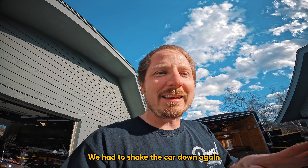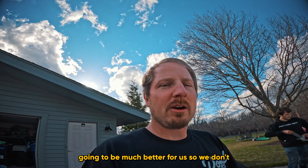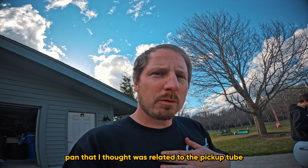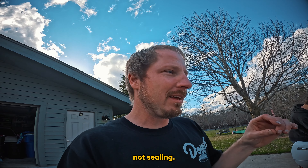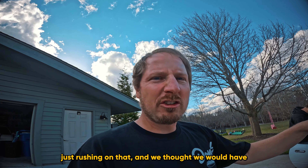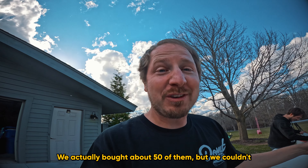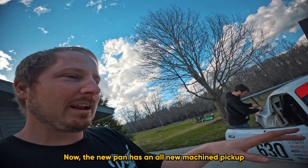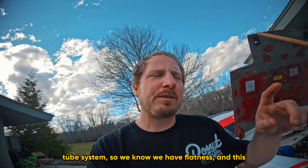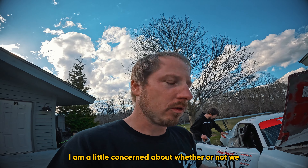Why is the custom oil pan in the garage and not in the car? Because we actually have a second revision of the oil pan in the car. We were having weird issues on the first pan — I thought it was the pickup tube not sealing, but it was actually the pickup tube location. We bought about 50 pickup tubes but couldn't find one to fit. The new pan has an all-new machined pickup tube system, so we know we have flatness and it performs really well.